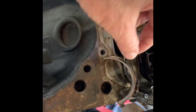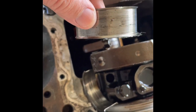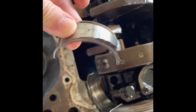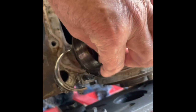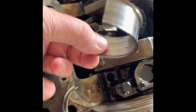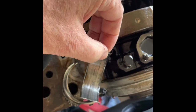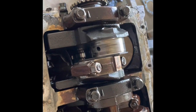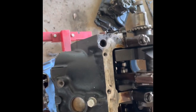The bearings themselves get hammered - here are the bearings that came out. You can see it's been flattened. The sides of the bearing have been pushed up between the rod and the crankshaft - that little wing is just metal that's been hammered and flattened, and excess from the heat has deformed the bearing and squeezed it out beside the rod and journal. Eventually this bearing will just disappear, you have metal on metal, and the rod will actually break from the heat. Once it breaks, it'll sling out through the side of the block or through the side of the oil pan because it's lighter and softer.